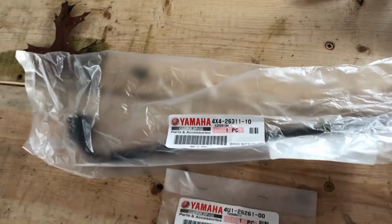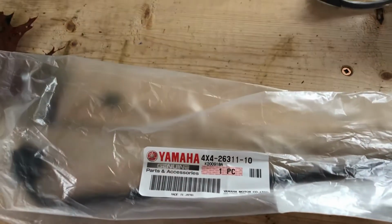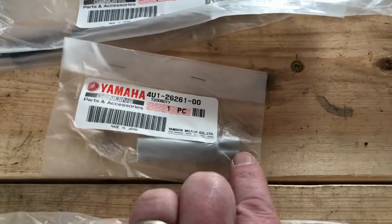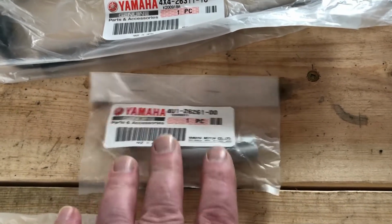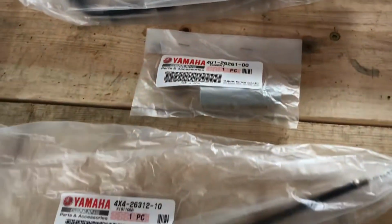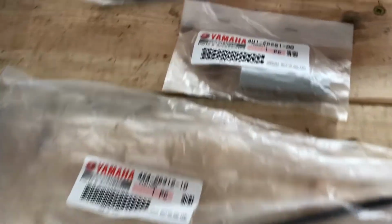The first part that we have is from the throttle itself on the handlebars, and this is the part number here, and this goes to the connector housing, which is this one here, basically just underneath the gas tank. Then you're going to have your two cables coming out of here, one to the carburetor and one to your oil pump. I don't have an oil pump installed on my bike anymore. If you want to check out that video, you can check it out on my channel. I ended up removing it and I mix my own fuel now. Then you have the cable that goes from the connector housing to the carburetor itself, and these are the part numbers for them.